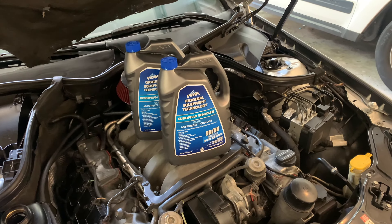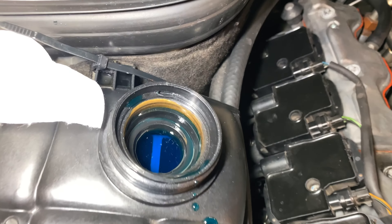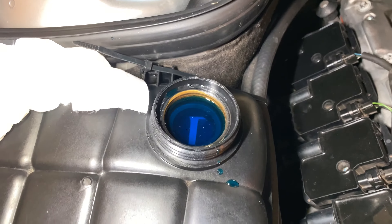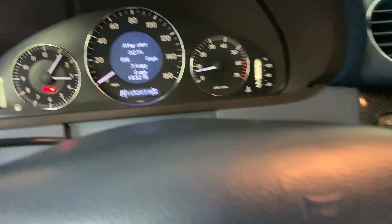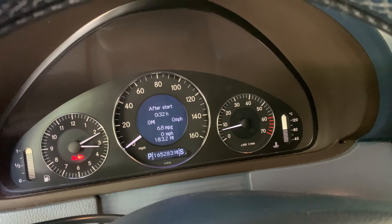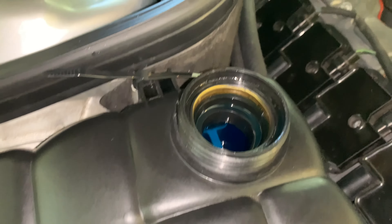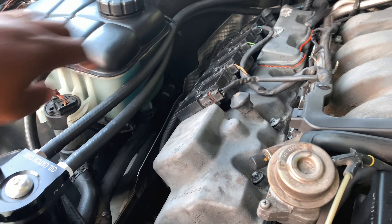I poured about two of those bottles in. If you look in there, there's still some space for more coolant — once I start the car it's probably going to drain down. I got it topped off with both of those 50/50 bottles and it still needed a little bit more, so I ended up pouring concentrated in there up to that level. Once it goes down, we'll wait until the temperature gets to about 80 degrees and the thermostat will reopen. Make sure you turn on your heat so coolant goes through the heater core as well, and then you'll see it suck back in. Got the temperature above 80, gave it a rev, hot air is coming out, and we're still looking full — so let's close this up and go for a drive. Everything is looking still pretty full, so I'm heading back home. This is all filled up.